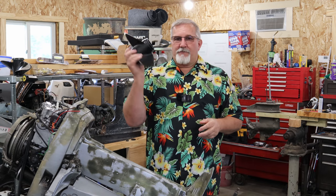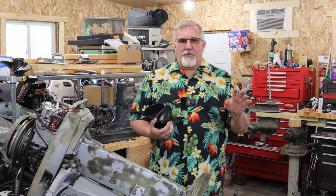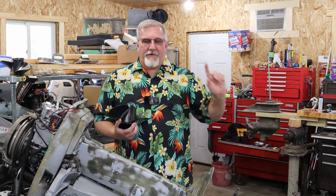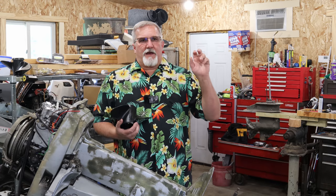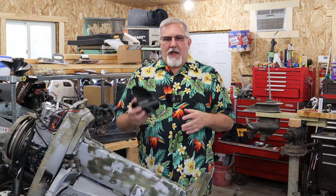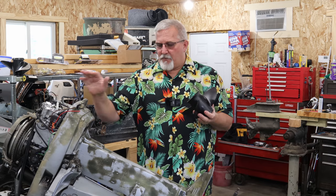Some people have told me, I've read your comments, you guys are doing great at leaving comments and helping me along with this stuff, that I saw one guy had an 11-pitch prop on his 35 horse and it scoots his boat along really good. Another person said theirs had a 13-pitch on it and it did really good. I'm kind of worried that the 15-pitch might be a little too much prop for this outboard.